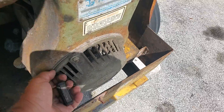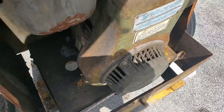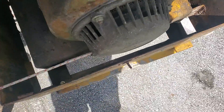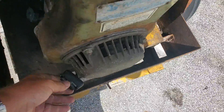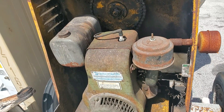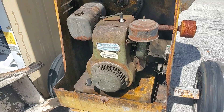Right now the flywheel is not engaging because I tried pulling it so many times. I think it's spinning but it's not connecting with the flywheel. It was turning over and it felt like it was going to start. I poured some starting fluid and it responded like it wanted to go, but I wasn't able to start it.